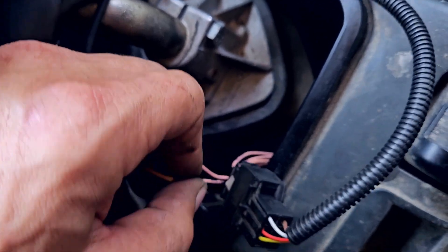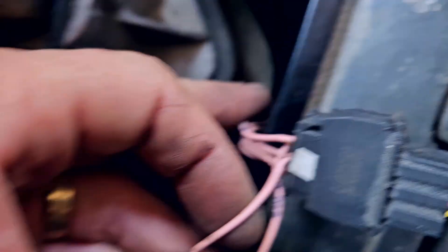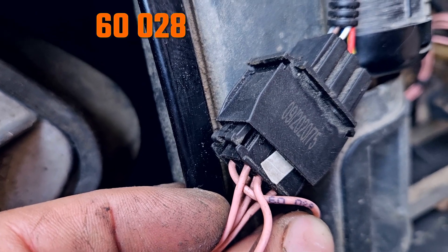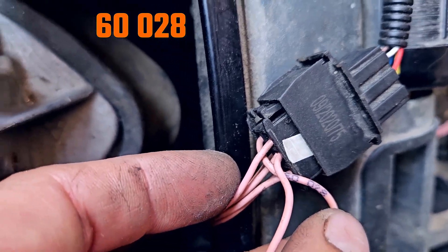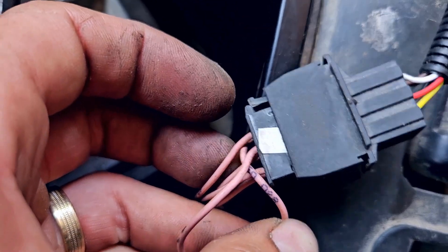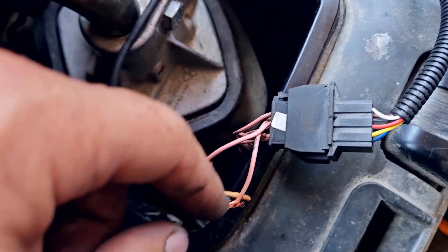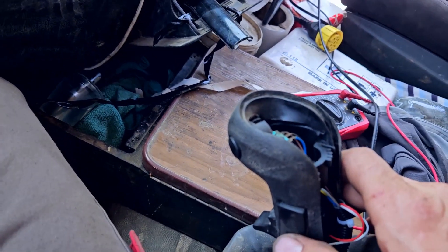In the lever plug you will have this wire — 1660002 to 8600028. On this wire you must have plus 24 volts, and in my case I don't have it. I've just powered this wire with plus.